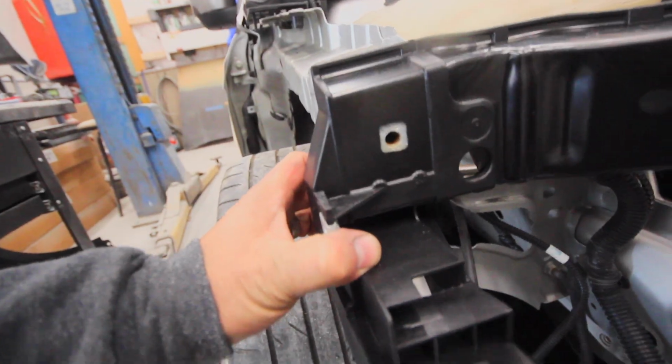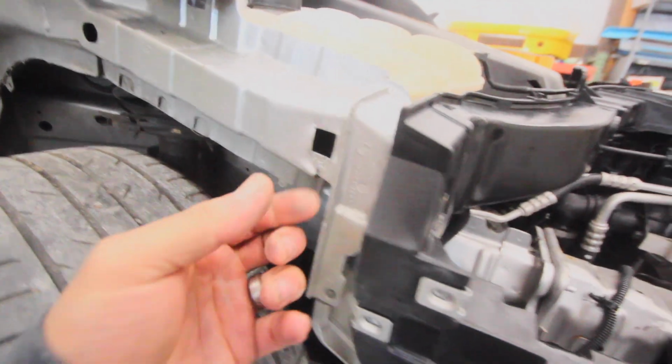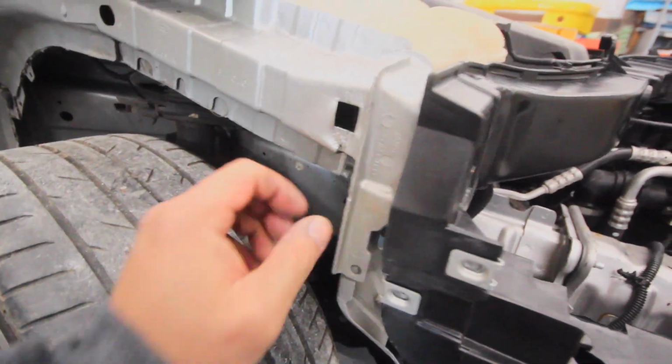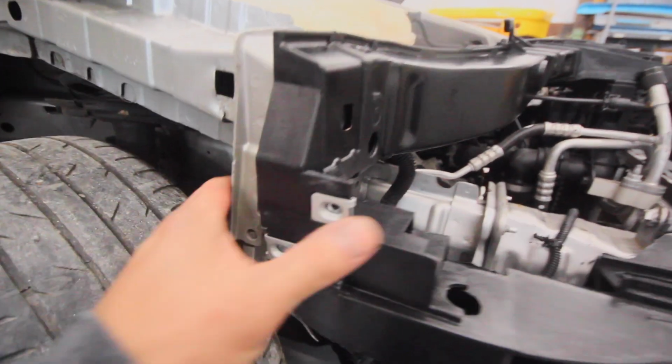As you can see, we got that piece to roll out a little bit, and we got this piece up and down better, and I did all that with the hammer. This spot, I hit the hammer a little bit in here, that got the bottom to roll out, and then this spot I actually put a pair of vice grips on and squeezed the buckled area and rolled it out a little bit.